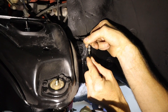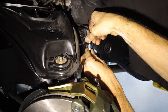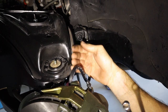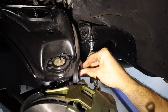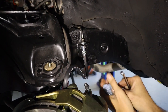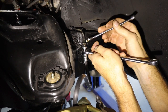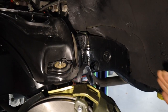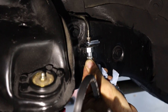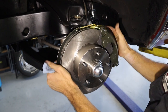Be careful now that it's all painted. Get the brake line snugged down. You can rotate the fitting so the line stays away from the upper control arm — you don't want it chafing or getting cut. This one lets it spin freely, so hold the line where you want it so it's not touching anything, then tighten it down. Wipe off all the brake fluid before it messes up the paint job. The new calipers came with a new retaining clip — push the brake line clip up into place and tap it in. Now the brake line is good with plenty of clearance.